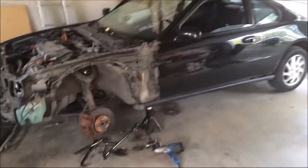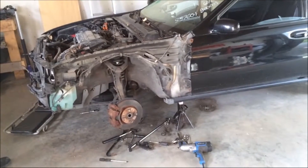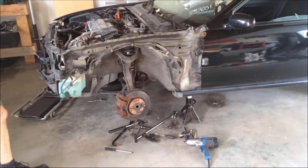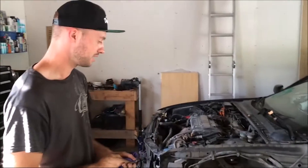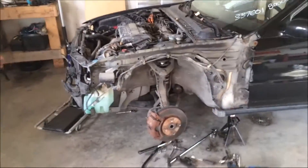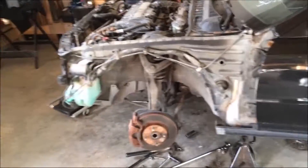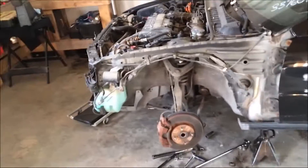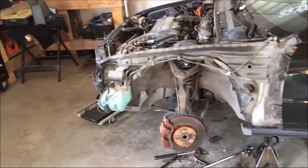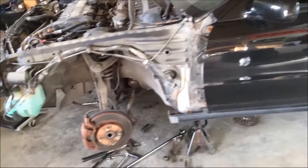Back to work on the Prelude. Today's project has been taking out the axles — took the wheels off, the axle nut out, banged the shaft out. Everything on here has been so easy to work on because nothing is rusted or fused. It's like working on a new car, something we've never experienced before. We've been able to get this done in record time — working under an hour on this car and we're already ready to take the shafts out.